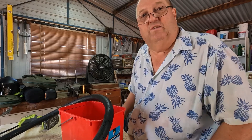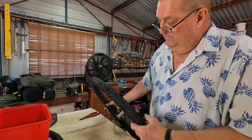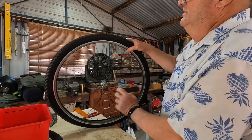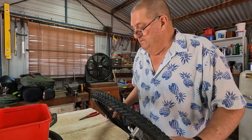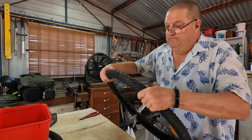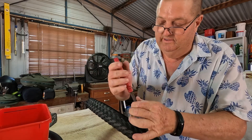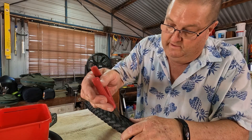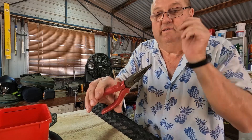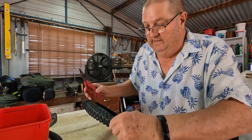The other thing we need to do is check inside the tyre to make sure that nothing is stuck in it as well. I just visually look at it first to see if anything is sticking out, because it might still be in there. Looking at this, I think I can see a Bindi — there it is. Looking at where the hole in the tube was, I get a pair of pliers and pull that out. Yeah, they're very sharp — that's what's possibly caused the issue.